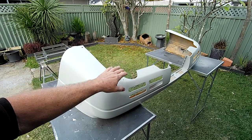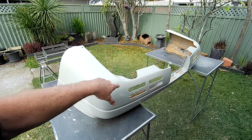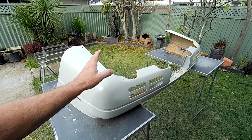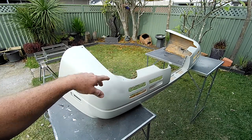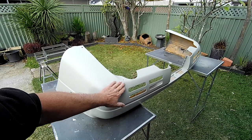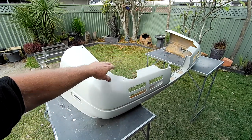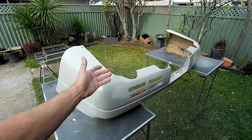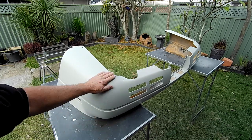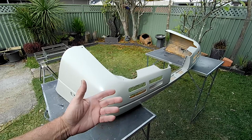The aluminium plate section I made for the bottom will be going back on once this is rubbed down — it's actually going to be fixed on permanently this time. It's got a couple of bolts that hold it in position. I'll be bolting it on and bonding it with urethane, and it will then get painted along with the rest of it as part of the primer processing. I hadn't fixed it on previously because it would have gotten in the way when rubbing out the texture around the edge. When it comes time to paint, I'll probably just paint the aluminium section in black and trail it through into the underneath of the vehicle. As you can see, most of the defects have been sorted out — it's really just a matter of rubbing down and re-priming, the same stuff we've already done but without the major repair work.